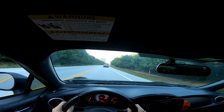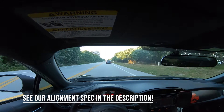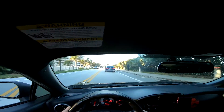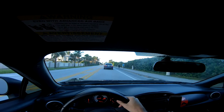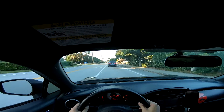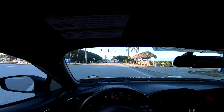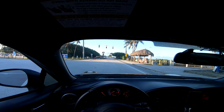We have retrieved the car from Ernie and it feels really good. Toe-out in the front feels a little weird — I've never really had toe-out in the front. There's a few characteristics that are a little weird; it's a little darty, more tendency to follow the road. On the flip side, one benefit is when you're turning there's not as much body flex. At zero toe I would feel the whole chassis kind of shift when you'd turn — with this, not so much. It feels a lot smoother, like the whole chassis is moving as one into the turn.